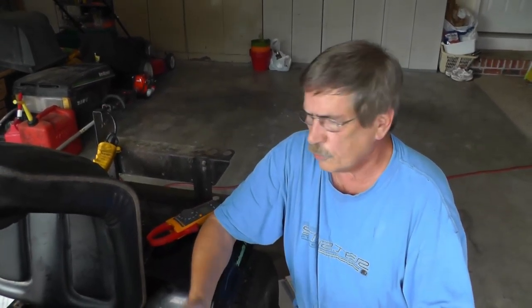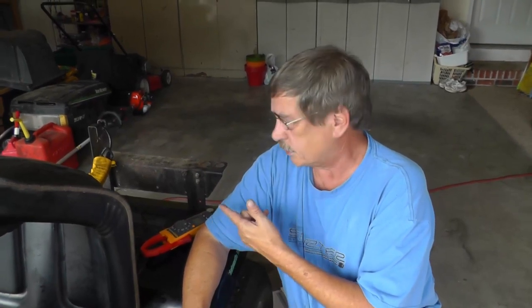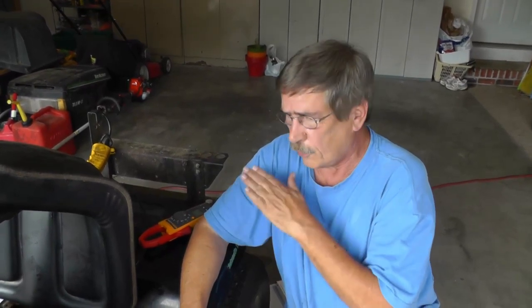And let's say that you're doing this and you've got 50 amps, okay? You see about 50 amps and you'll notice that your voltage is not dropping down as much. Well, the more current that comes out of your battery, because of the internal series resistance, the lower that voltage will be. That's normal. But you're not looking for it to get down under 10 volts. Look at 10 volts as being your very minimum.